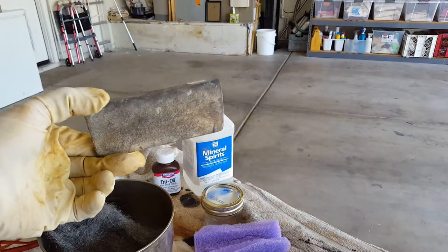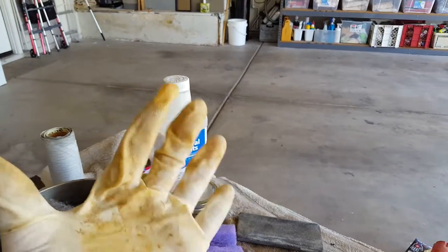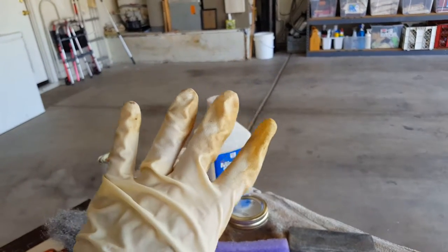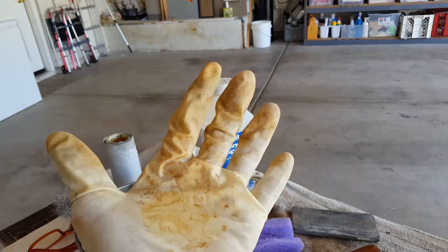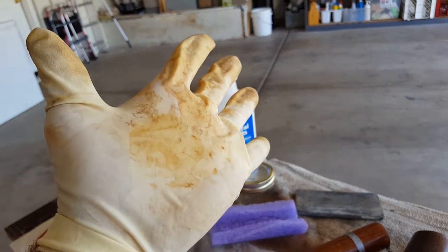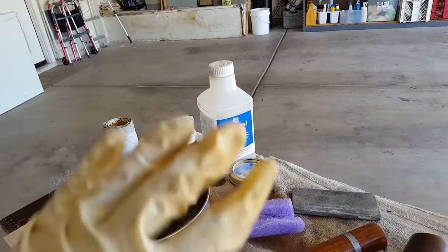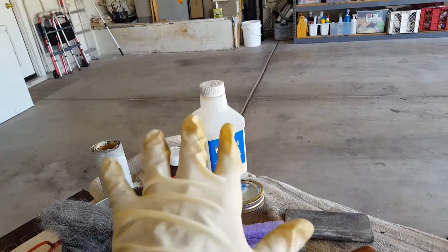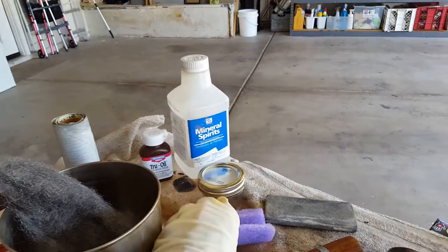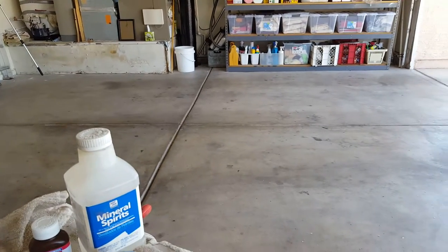For the other flat pieces, I used a piece of real hard foam — we used that when we were sanding cars. You want to make sure you don't use your fingers, because you'll push with your fingers and leave finger marks or finger grooves. We had that problem when painting cars — you finally get the paint on and there are grooves in it. So use something flat and kind of soft. I use this noodle for the curved pieces; it worked really good. I just invented that.